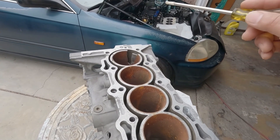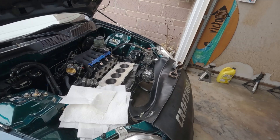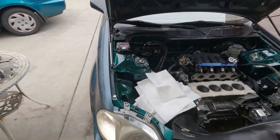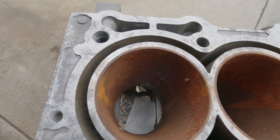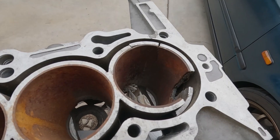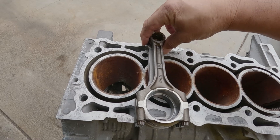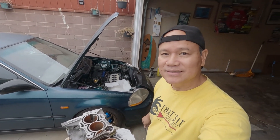For the cost, the dry sleeve will be less than the wet sleeve, of course, because of the materials used. In my experience having both, it doesn't really matter for coolant temperature — what you really need to pay attention to is the size of your radiator and a good fan. To conclude: when you send your block to a machine shop, mention the relief and inspect that they removed the necessary material when you pick it up. Remember, aftermarket rods are considerably wider than OE. Thanks for watching — leave a comment and I'll see you guys next time!